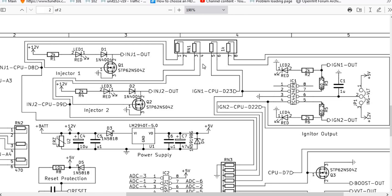So anyhow, if we just take these two LEDs and physically move them, but leave them soldered where they are, we would have injector 1, spark plug 1, injector 2, spark plug 2. Now we'd be looking at the cylinder, and it would make more sense, because we would see blink, blink, pause, blink, blink, pause, blink, blink, pause, blink, blink, pause. And if we don't see that, something's wrong. So they could be extremely helpful if they had just swapped these two LEDs around. Okay, and again, these aren't the LEDs, they're over here. I'm just using this as an example.